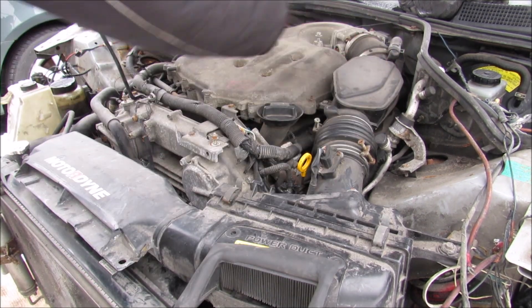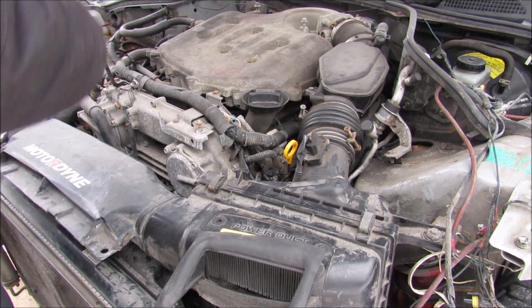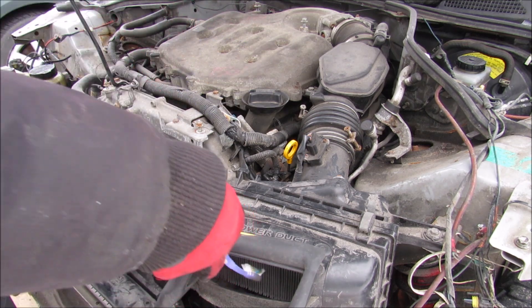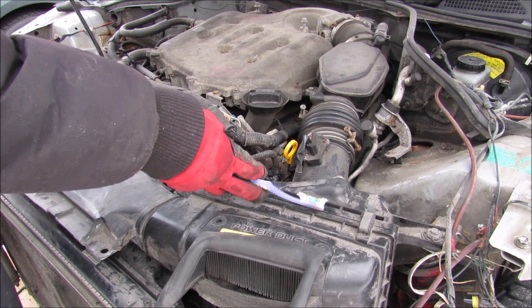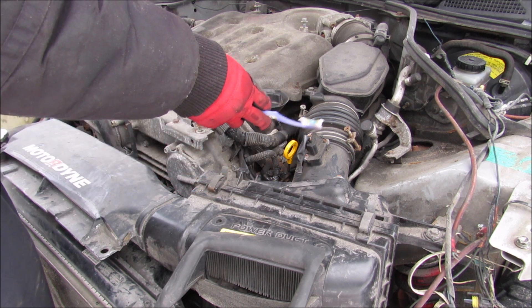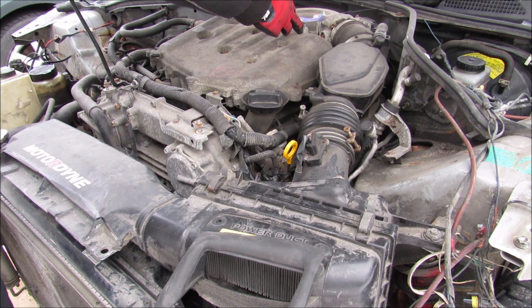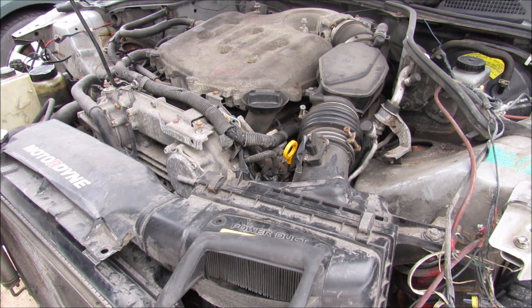Today I'm going to show you what's inside of your car's air intake and how it works to feed air into your car's engine. The air intake system consists of a couple of parts, starting with the fresh air intake near the front of the vehicle where air goes into the air box, which has the air filter, then through the mass air flow sensor, through a little baffle to reduce resonance, through the electronic throttle control, and then into the giant air intake plenum where air collects and is distributed down into the engine head.